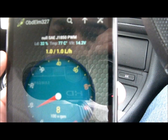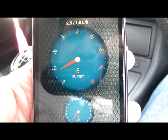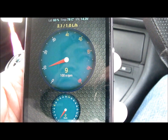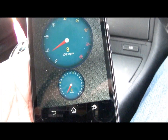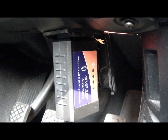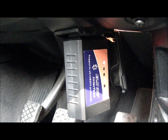As you can see, it's all communicating now. It's telling me the engine coolant temperature. Now if I rev it — there you go — it's acting as it should be. But it's just an example, so you can connect any paid software with it. It's just that the pairing can be a bit painful sometimes, but once you get a hang of it, it won't be a problem. Once it's paired, let's have a look at the car — you will see the lights flashing like this, going upwards then downwards — the yellow ones. That means it's communicating fine. That's the sign you're looking for.